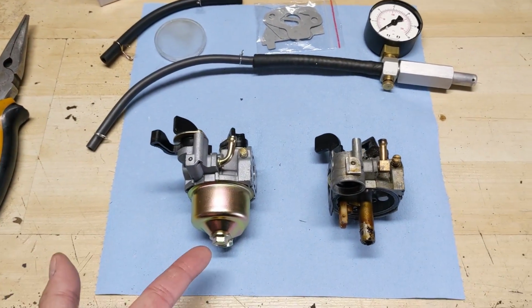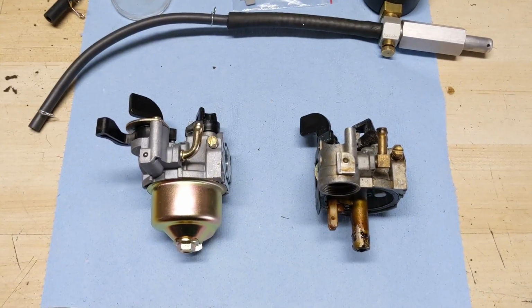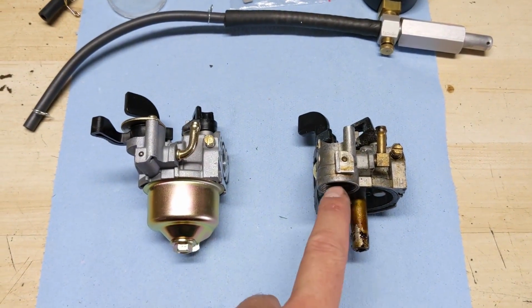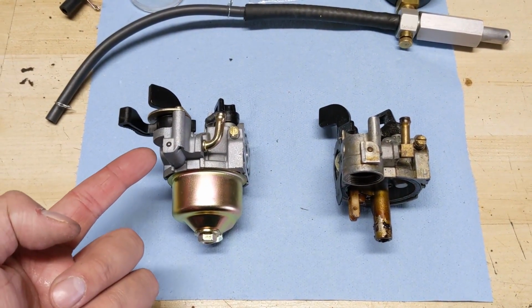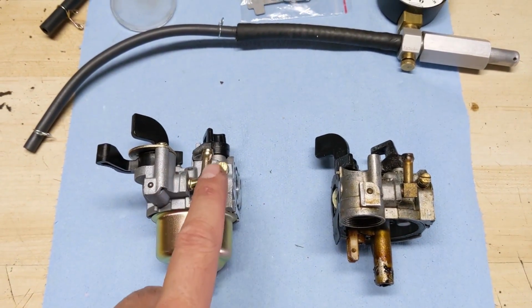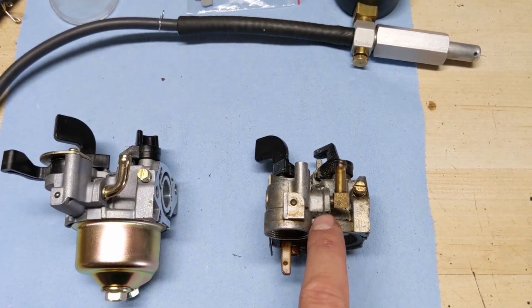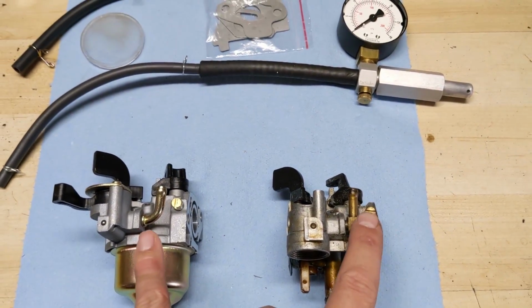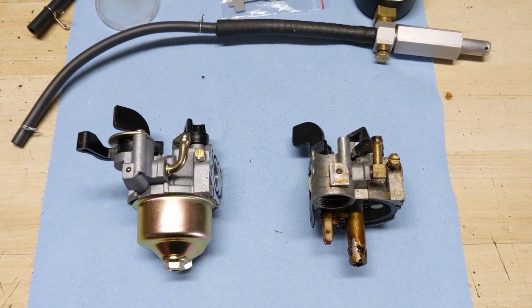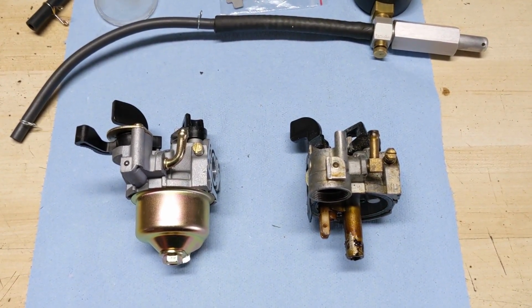And then obviously we have the carburetor. So the first thing you might notice is on the original, we had that big long sediment bowl for the fuel valve. On this one, we don't have that. It's just the fuel shutoff valve. We have a bent fuel inlet there, whereas this one has the 90-degree, but you're gonna notice they both have the fuel adjustment screw, which is going to be nice because it will give you a little bit of adjustability.